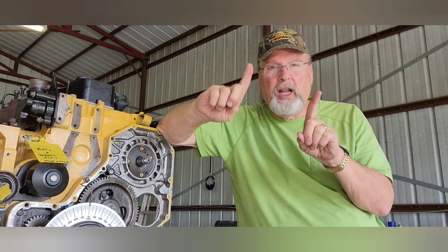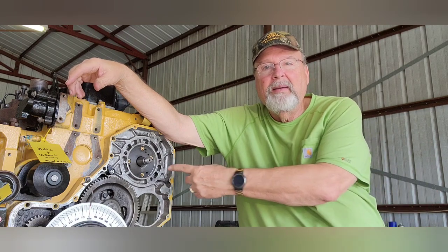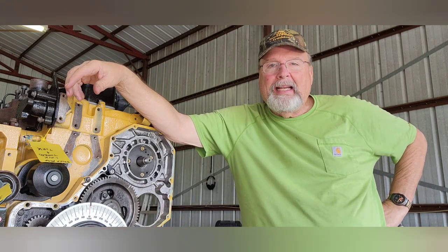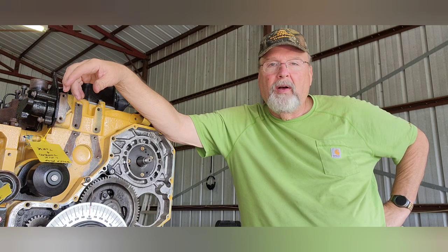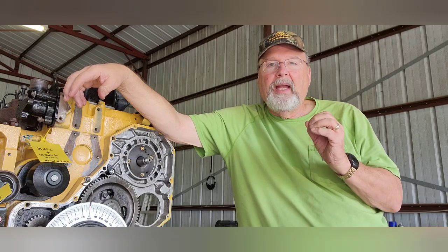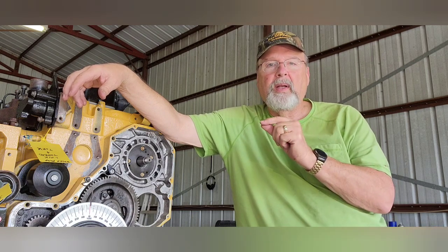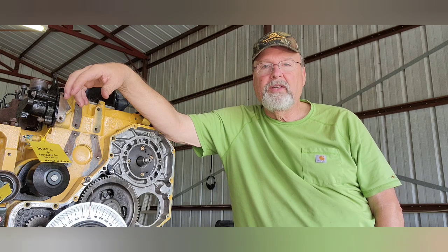Welcome in, everybody — Episode 11. We've got the old Cummins about ready to time out. We've got the P-pump in and all we have to do is hang the gear and get it timed out. We're going to time this thing to about 18 degrees. A friend of ours coached us a little bit on this since it's my first Cummins build. He went for a little more horsepower and timed his up around 20. I'm going to do mine around 18. This one was set at the factory at 12.5, which is really mild, but I'm going to set this one up to 18.